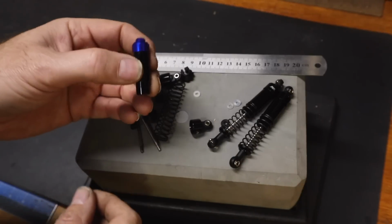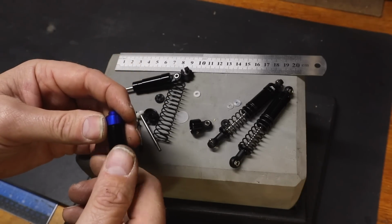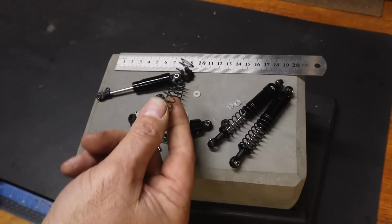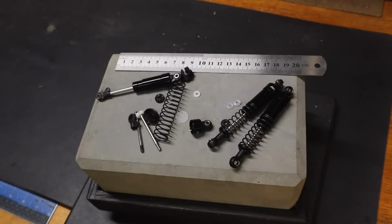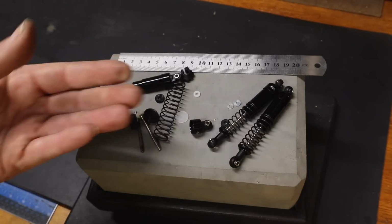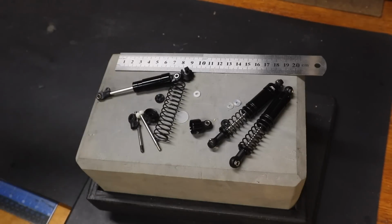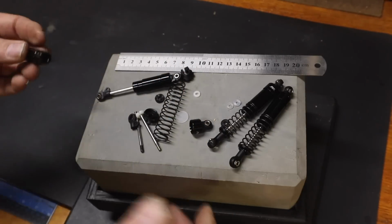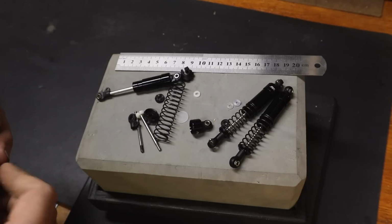You can go all hodgepodge, but for the normal folks, not recommended because of this. Not even because of the 5,000, 7,000 thing. I like a shock that does not leak at all. And if I can't have that, I would prefer a shock that leaks very slowly. And if you put 400 weight oil in your shocks, guess what? They're going to leak more slowly, if at all. So, there you go. KYX, not Dravtechs.